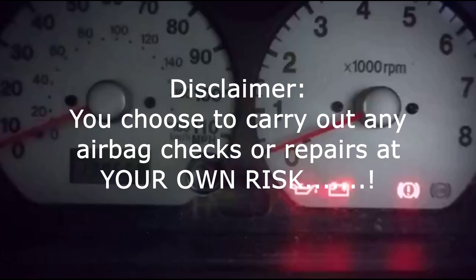I downloaded the Suzuki manual for this car from one of the Suzuki forums — I'll double-check where that is and put the link in the comments. There are a number of manuals, so you need to make sure you get the right one corresponding with your VIN number. On my car the VIN is under the bonnet, behind the battery on the bulkhead on a plate. Verify you've got the right manual, otherwise you'll be looking at the wrong diagrams and the wiring will all be wrong.